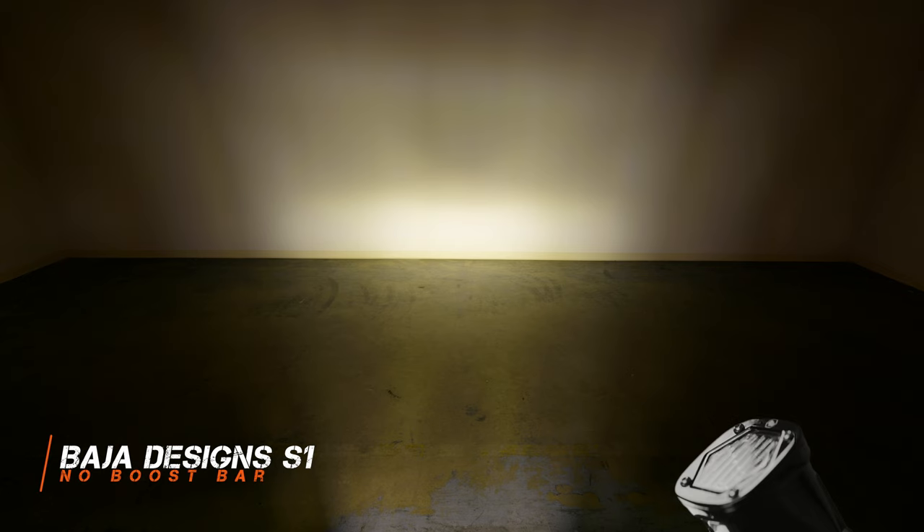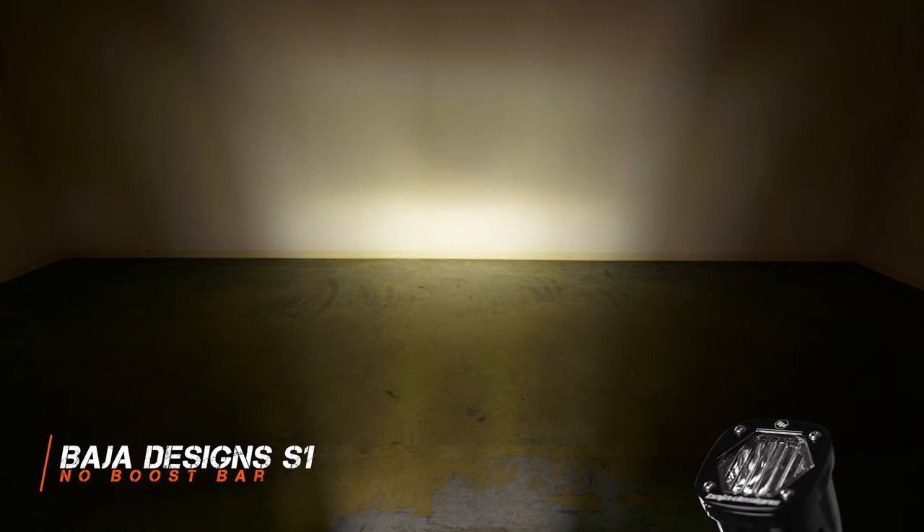We have this truck backed up about 20 feet from the wall and I'll measure it with a digital lux meter. The first hitch mount is the Baja Designs S1. As you can see, that looks insanely bright, but I'd like to see a little more width. I measured at the brightest point 590 maximum lux. I'm interested to see how that compares to the Diode Dynamics. In reverse with the Diode Dynamics SSC1R, it's not nearly as bright as the Baja Designs. However, it does scatter the light a lot wider. But it is substantially less bright — the Baja Designs hitch mount was 883% brighter, almost nine times brighter at the brightest point. That's a fail for Diode Dynamics on brightness.